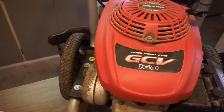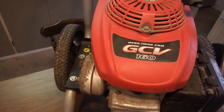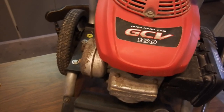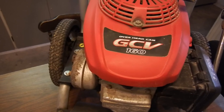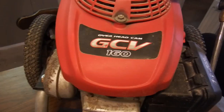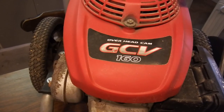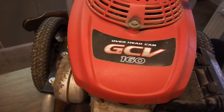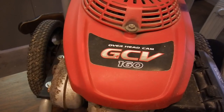The all-new GCV series underwent a fundamental overhaul in the engine frame, including optimization of the structure and its component parts, which resulted in a weight reduction of 4% compared to the previous model. Class-topping power and torque were realized with further advancement of combustion technologies, including a change in the shape of the combustion chamber from a bathtub design to a pent roof design.